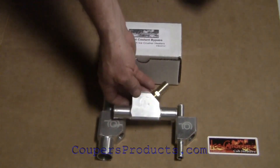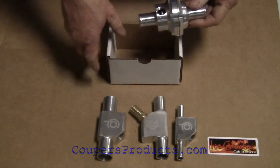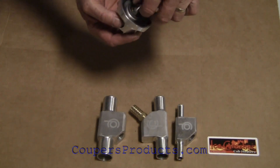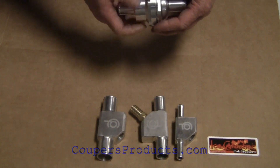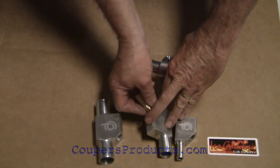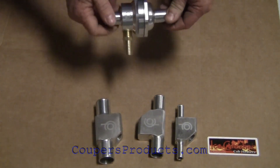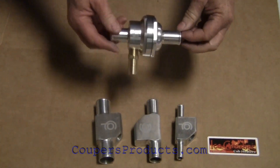To rectify that, what we've done is made this MaxStat coolant bypass. It's a very simple unit — it consists of a housing with a thermostat in it. What we do is remove the Y fitting from the top radiator hose and replace it with the MaxStat.